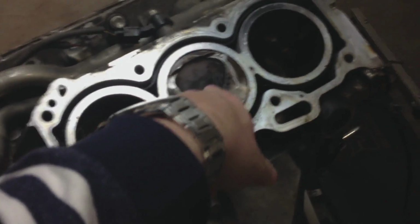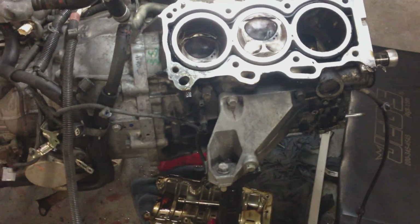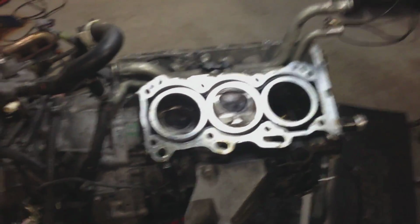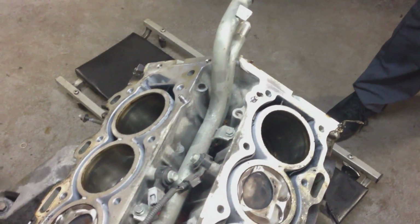So really quickly, I'll just tell you, they took the engine apart. They cleaned off the carbon deposits on top of the pistons. The reason those carbon deposits were there was because the piston rings were, I guess, not engineered properly. Carbon deposits were not supposed to be there, so they have to clean that off. Some people are actually getting the entire pistons replaced. Mine, apparently, only needed a cleaning. Then they replace the piston rings themselves with a new design that would prevent this problem from ever happening. And since everything is apart, you're getting an oil change out of it. They're changing all the seals. So it is a pretty big service. I'm sure that if you paid to have this done, it would have cost you probably over $3,000 if you had to eat the cost.